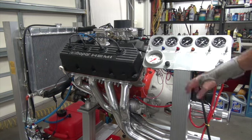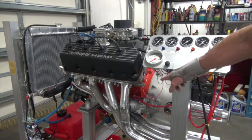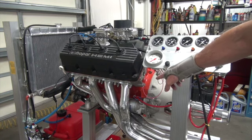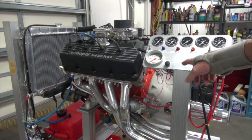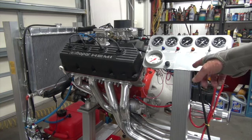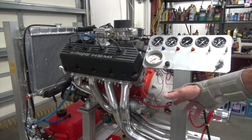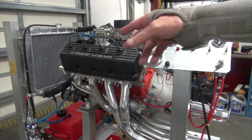And then the starter button, it's like a race car electrical system. You've got a Ford solenoid back here, and then one cable going to the starter, and then you've got a jumper wire over to the solenoid to kick it off. And then a Mopar mini starter. I just told them I wanted it like a '70 Hemi Road Runner, so that's what that is. That's a knockoff aluminum bell housing, and I used an aluminum flywheel just because I'm too old to pick up a steel one. And TTI 2 1/4 headers, and the radiator is '70 Road Runner also, as are the hoses.